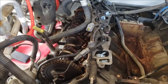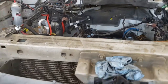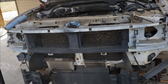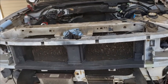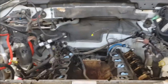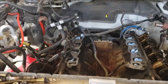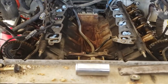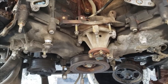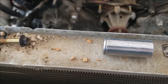I don't want to damage anything — I want a nice smooth removal. This model Ford, you can't take all that front stuff off like you can on later models where the engine compartment is wide open. On this one you can't unbolt the front piece of the frame, so it stays. I am going to remove the radiator for two reasons: number one, to give me a little more room when I go to break that crank bolt, and two, it'll be easier to install my electric fans on the radiator if I can lay it down on a flat surface.